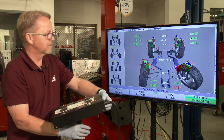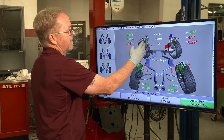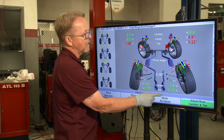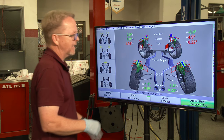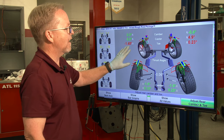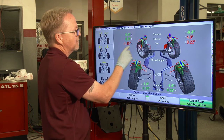We're going to look at this with a rack and pinion taken out of a vehicle. On the tie rod ends, notice this one has about an inch and a half of threads showing, while the other has less than half an inch. That tells you someone may have adjusted the toe incorrectly — they extended one way out and left the other in, which would likely cause a crooked steering wheel. This is the situation on the Prius: one side is turned way out and the other only a little. Another cause is a technician replacing tie rod ends and not getting the same number of threads on each side.